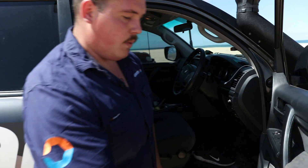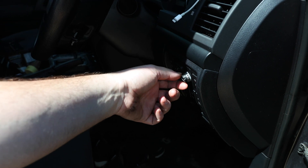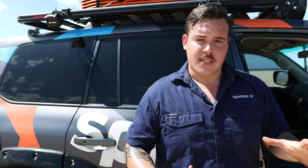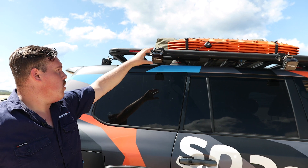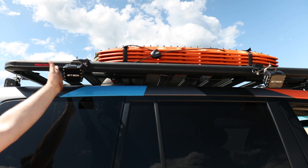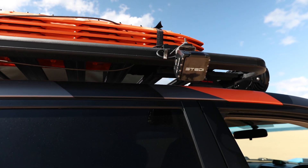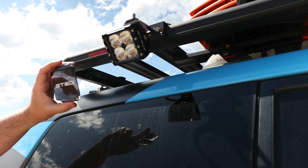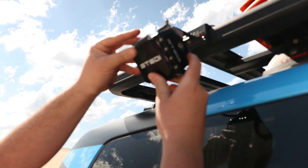We'll quickly show you inside the cockpit. Keeping with the theme of the Stedi lights, we've got all the Stedi OEM factory-looking switches in the dash, so we didn't have to cut, modify, or drill any holes. We've also got a Redarc Tow-Pro Elite V3 for when we tow the big trailers. Over in the centre console we've got the Redarc gauges — measures voltage, EGT, boost. We've also got the GME XRS Connect 370 in the car. The car's been tinted. Up on top, we're running a Yakima all-alloy roof rack with Yakima accessories — recovery track holders and a DriveTek awning. We're also using the Stedi C4 flood work lights — six of these on the vehicle, all controlled from inside the car and mounted to the second battery. They cast a stack of light. The great thing about Stedi is they have cool clips — when they're not in use you pop the clips on to protect and black them out, and when you want to use them at camp, you just pop the clip off and away you go.